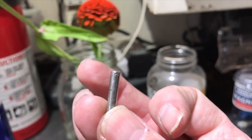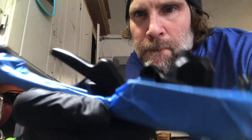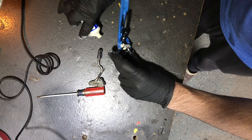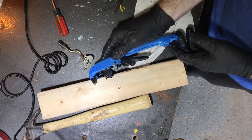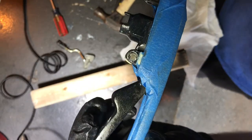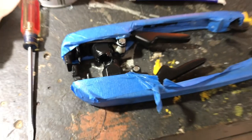They look pretty good. I used some masking tape to protect the paint, and that was the best way I found to get these things to go together. I mixed up some lube and forced some grease into the mechanism. One was tighter than the other, but once I got it in there — boom, shakalaka. I tapped it down one more time with a punch. All right, we're good. Got to do the next one. There it is — that's how you fix door handles without buying any new parts.